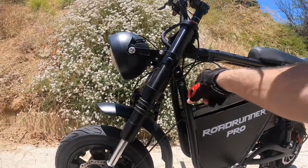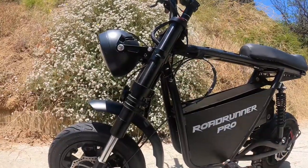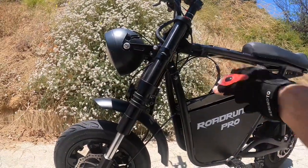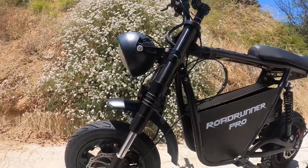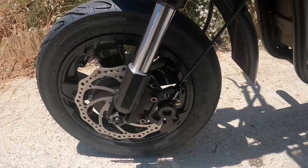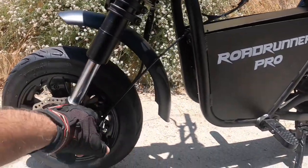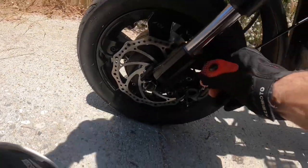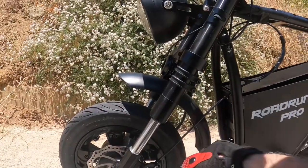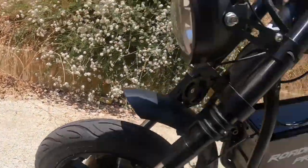My mechanic Ryan was saying you can route the line but you have to make big loops — you can't fold these hydraulic lines because there's pressure in there. I still know this is not a good thing long term. I just wanted to get on the road. These are the brakes, and I'm pretty happy with the performance. They feel like they're working — they grab the disc the right amount. The top of the disc is right at the very top of the caliper, which means it's really grabbing a meaty part of the disc.